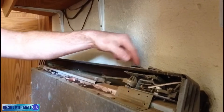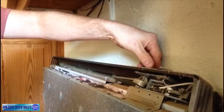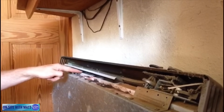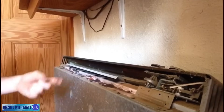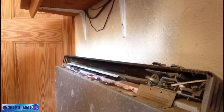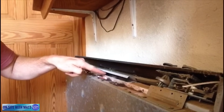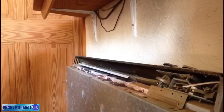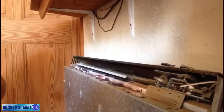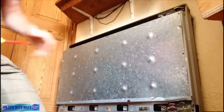When the output dial is turned fully anti-clockwise, this flap here is closed. As I turn it clockwise it lifts this flap, which allows heat stored inside to escape out into the room - it's actually a boost button. So in the evening if you want a bit more heat, you just open this clockwise and heat escapes from in here into the room, giving you a boost of heat. But you must remember before you go to bed, when the room is hot enough, to turn this dial fully anti-clockwise again.